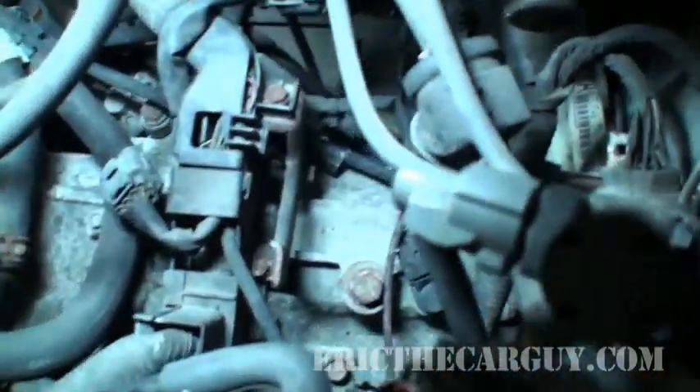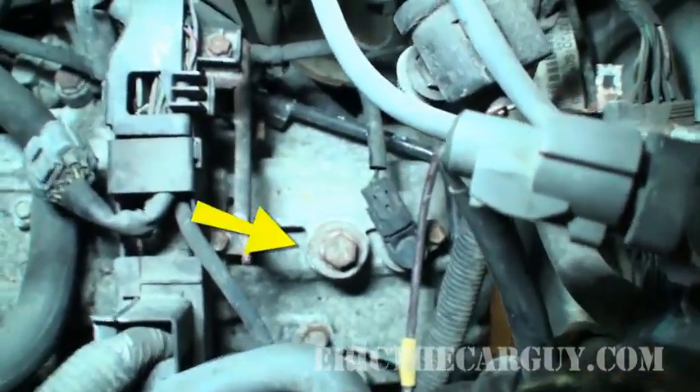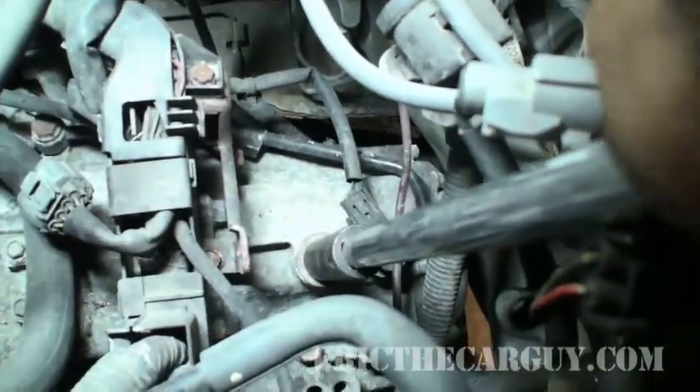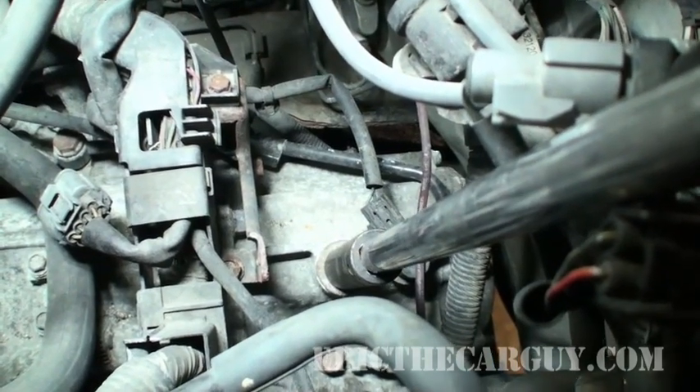While waiting for the fluid to drain, open up the fill plug — that's the one right there. It's a 17-millimeter head; I use a half-inch ratchet to knock it loose because it is on there. Now, some Hondas won't have a fill plug like this. These V6s do. On the four-cylinders, the dipstick has a big rubber grommet on it — you fill it through the dipstick hole. If you've got a small skinny dipstick, look for a plug like this; if you've got a dipstick with a big fat rubber grommet, fill through that hole.